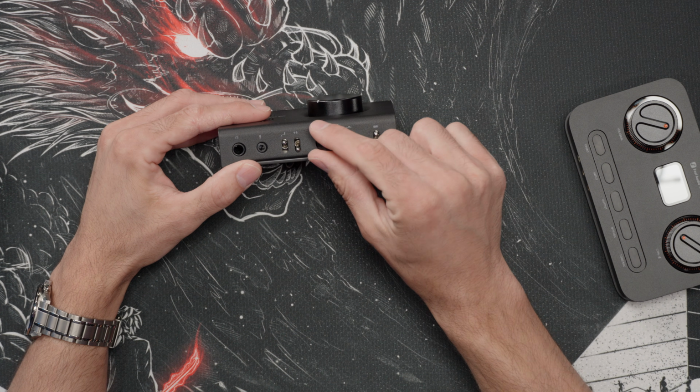And this one is the width knob, which is basically crossfeed. It kind of blends some of the sound from the left channel to the right to break the barrier that is your head between both audio sources. Because when you listen to things in real life without wearing a headphone, if you cover one ear, your left ear is still hearing some of the stuff to the right. And the idea of crossfeed is to simulate some of that effect.